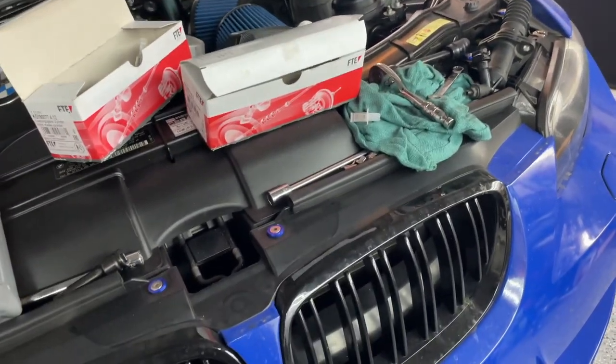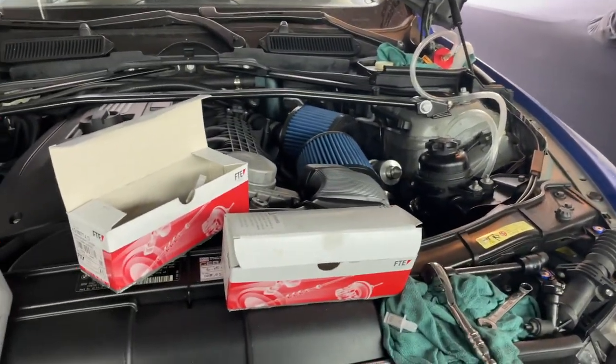Looking down, you can see more of the pressure plate. Unfortunately with this borescope I couldn't quite tell what my exact issue was. My transmission actually had a clutch issue — it lost a spring. The pilot bearing failed, which then caused the withdrawal bearing to fail, which caused a chain of events — next thing you know your clutch is fried. The pressure plate was also fried, and so was the flywheel. I found that out later when I dropped the transmission after doing the slave and master cylinders.